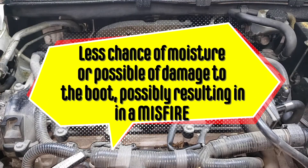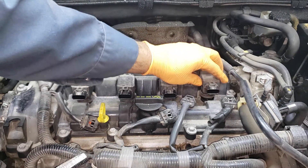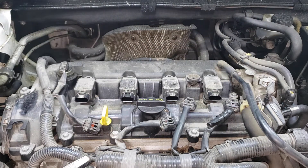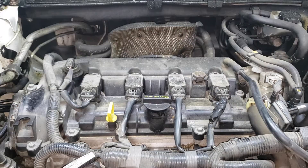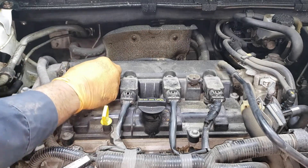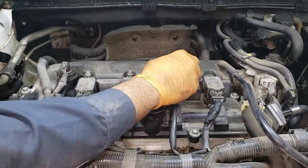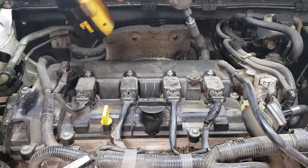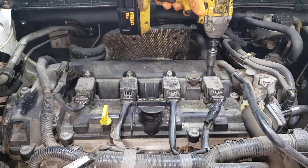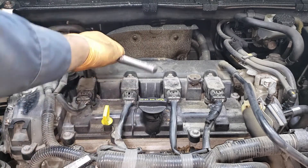With all your coils clean and ready to go, you can now put them back into the engine. Go ahead and put your connectors back — be sure not to mix them up. Now put the bolts that retain the coil back. Turn them in by hand a bit and then you can fire them home with your gun. Remember to be easy on them, they're just coil bolts. Then double-check the torque with a ratchet.